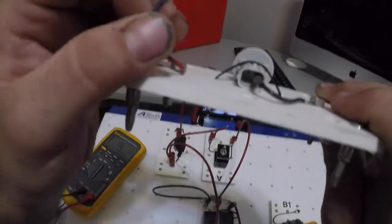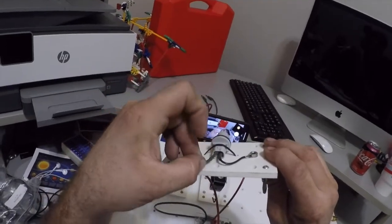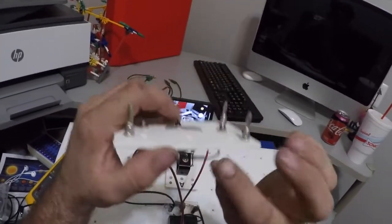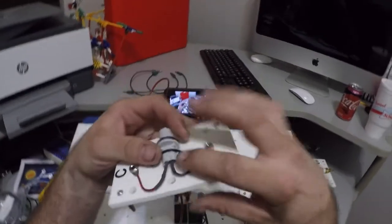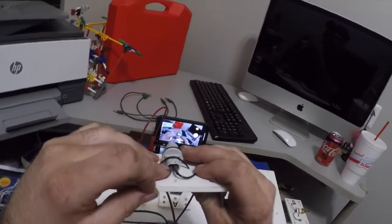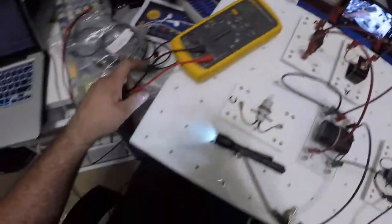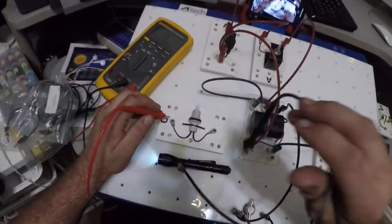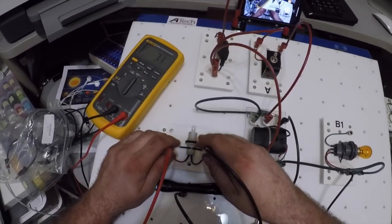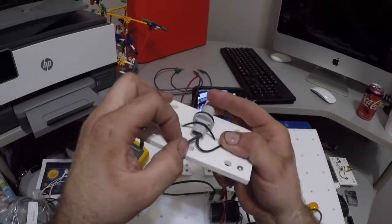This one was disconnected. Okay? So we got to be careful, make sure these are always connected. Okay, so we slide it back in there. And it looks like I still missed it. So we make sure we can get it in. Okay, so the way we test it, we measure for resistance again, and what do we get? I got 7 ohms of resistance. That's high. Maybe it's not touching, or it's not in all the way. Yeah, I think it was.